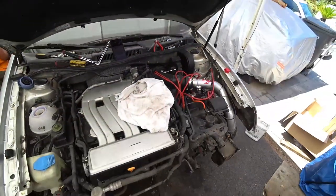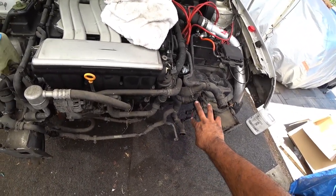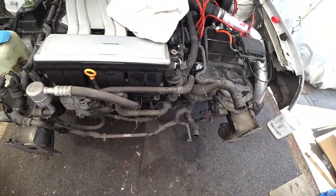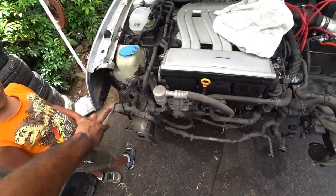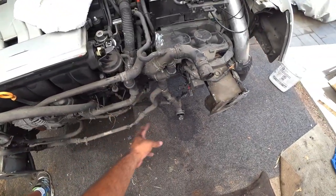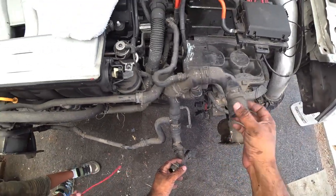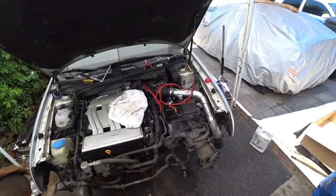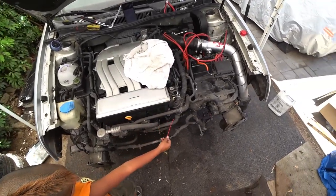The secondary radiator is not sequential — it's actually like a side radiator. It literally just sits on the side. If you guys could see, there's two lines right here — they go down this way and feed off of the main lines. They don't have sequential flow, which is why I think they're just useless. We just have to go to a bigger front radiator and that would solve that problem.